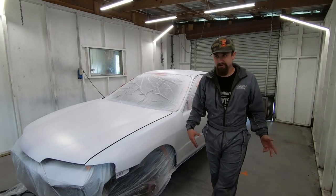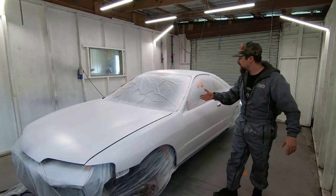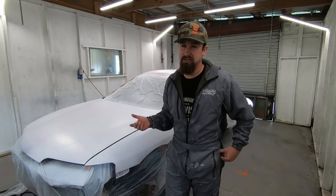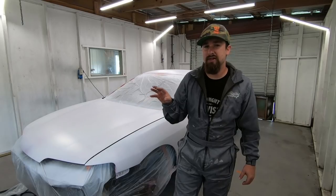Down, we are looking pretty good to go right into base coat. Now, as we're going with the sealer, if any kinds of little bugs or dust nibs hit the panel, you can just go ahead and take some 600, wipe them right off right away. This will be dry within minutes after you spray it, if you're mixing and doing everything that you should be doing correctly. So let's go ahead and get into that base coat.